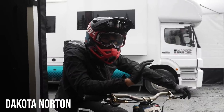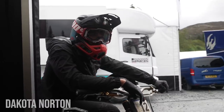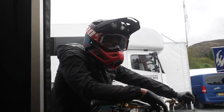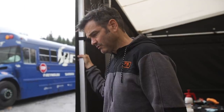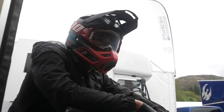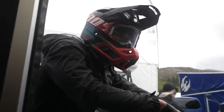25% sag — too soft. The front wheel rides up the corners. You could add a little compression. And once you start getting the compression in tight enough to hold it up, it's too rough. Well, it's not rough exactly, it's just harsh.